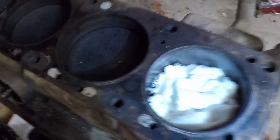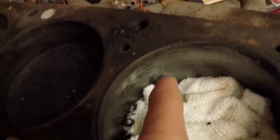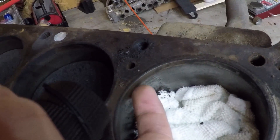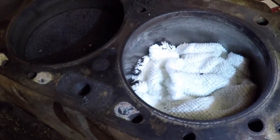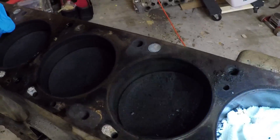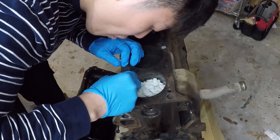So let me give you guys a close-up look. There's the ridge that I just cleaned the carbon off of, and here is an area that I didn't. Going back to this area, if I run my finger along the ridge, I can still feel a slight level difference, but it's nothing that I can catch my fingernail on — it feels really pretty smooth. And this is a great sign for the engine — it probably means that the cylinder walls don't need to be re-bored, which saves me a lot of money because I want to keep this engine relatively stock. So that's great news.